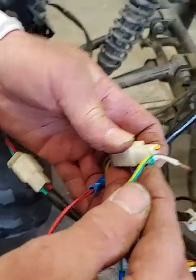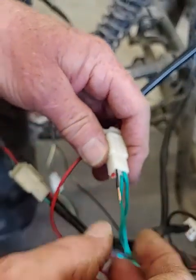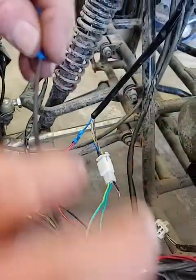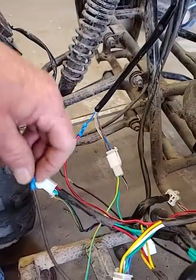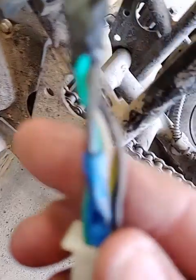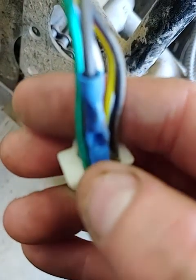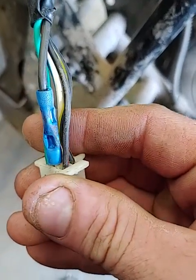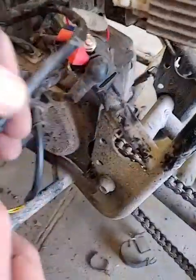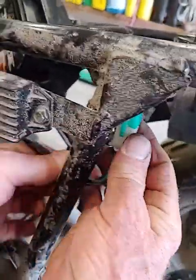Here's the black with white stripe — whatever you want to call it — that's the safety kill wire. It goes to your CDI box. We've run a new wire to it, just a black wire. That's the fifth wire we were talking about earlier — the gray/black-looking wire in the dead center of the connector, in between the green ground and the red and black wire. That goes into the CDI box. We're gonna do some taping up here to clean and neaten this all up, and everything should work now.